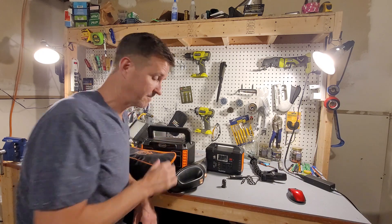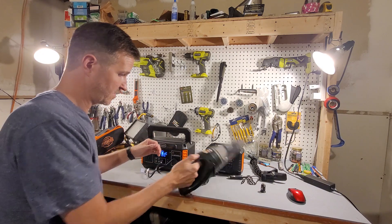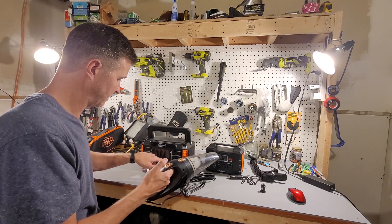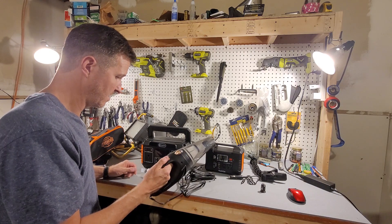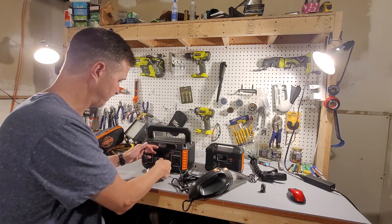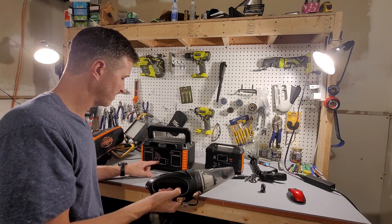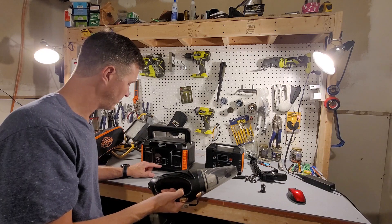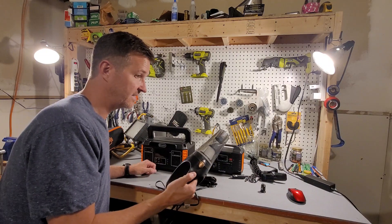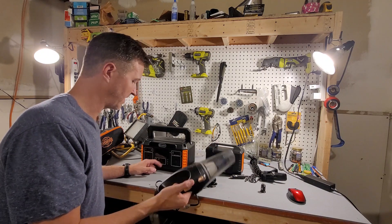So I want to see if it will work with this bigger unit. I turn on the DC output, plug in the vacuum, turn it on — and it still doesn't work. That's super disappointing. Even with the small adapter it doesn't work. The DC outputs say they do 10 amps, and this vacuum only draws 8.8 amps, so I'm guessing the initial inrush current is too much. Still pretty disappointing that I can't even run a small vacuum on a full-size DC plug.